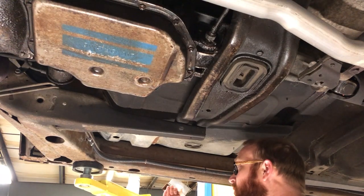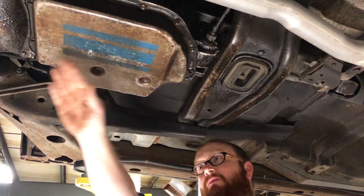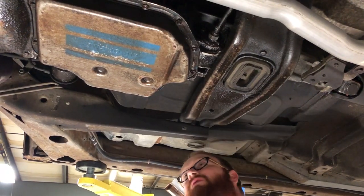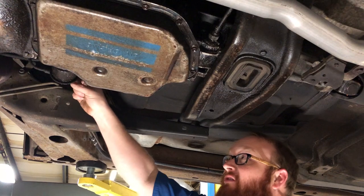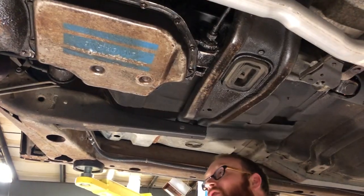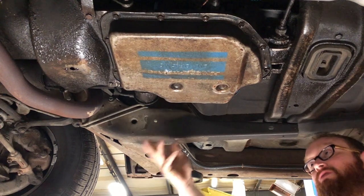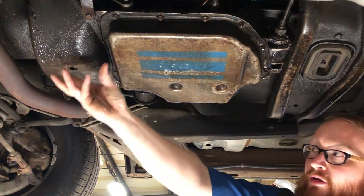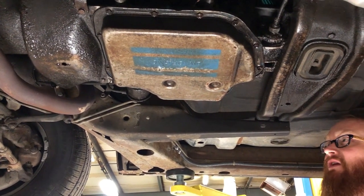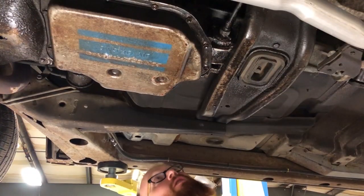When the vehicle's on the ground, get down and look underneath. The transmission pan on this one is coated in oil — the pan gasket's leaking. I'll put in a new filter, surface it, and repair that. I've also traced a leak back to the valve cover gaskets; this one's leaking oil down the torque converter cover. If anything's wet under there, it's obviously a leak. Then you ask where it's coming from — check the valve covers, or is it a rear main seal leak?